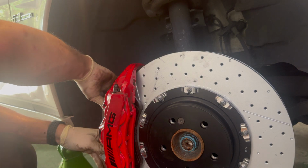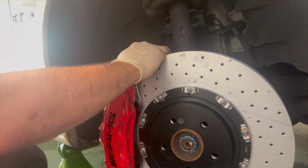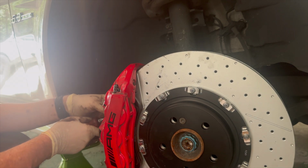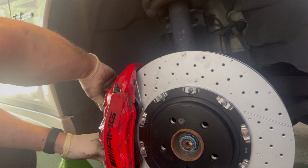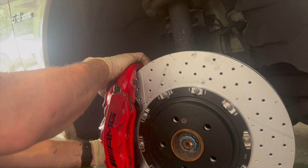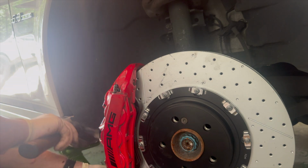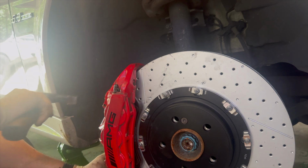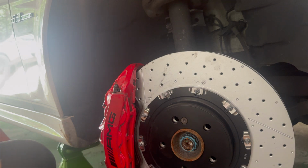And grab our new pad, and slide that in. Sometimes you may have to adjust these pistons just a little, just in case one of them didn't push all the way back in, because it's a 6-piston caliper. And having 6 pistons, you've got more pistons to worry about. Tap that all the way in, make sure it's nice and straight. We'll get our new hardware,